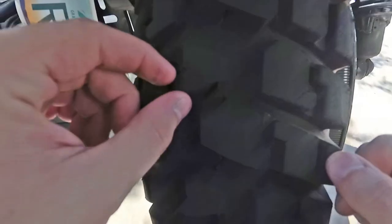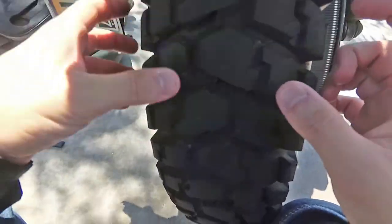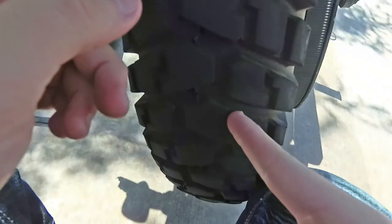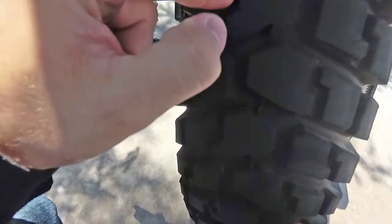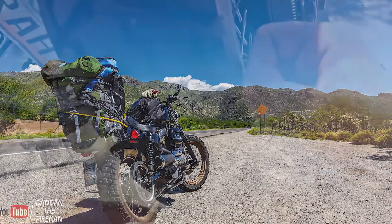It's a little dirty, but I'm going to try to get really close because this Yi 4K likes to make everything wide. For the past five or six hundred miles I've been mainly on road and haven't really done off-road, so I'm starting to see some wear. The wear bar is right here on this side. You do not want it to get super low. I wish I had a coin or measuring tape, but I am having a little bit of cracking on the tread and some wear. I'm actually using the sides now because I've been going more aggressive, especially up on Mount Lemmon — I was aggressive and got really close to the edge.